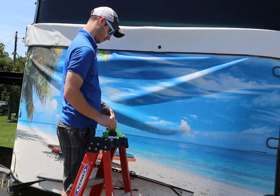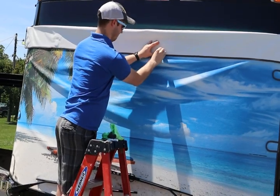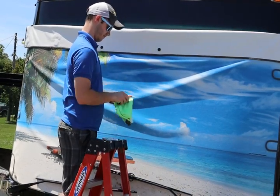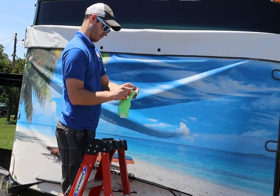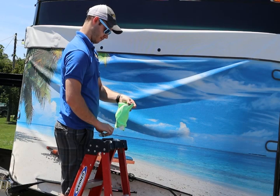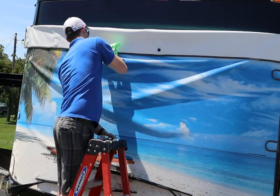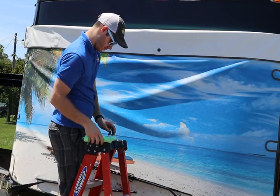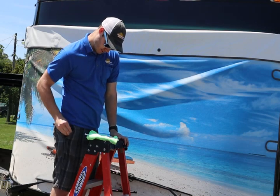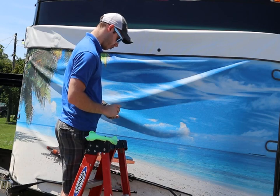Now getting ready to set the upper exterior magnets — very similar to the side shade application. Place the black magnet on each pocket and scoot them up towards the hem. Wipe off the magnet and place an adhesive dot on each one. Starting with the two center magnets, simply lift the shade up, give it a little stretch and pressure against the glass, and move along the top. There will be six magnets across the top — very small but still very powerful, and they'll blend in with the dark glass.